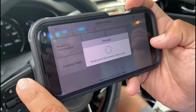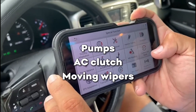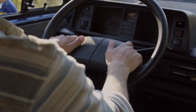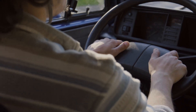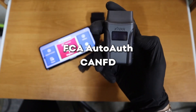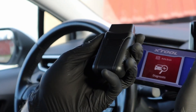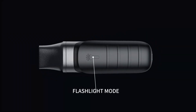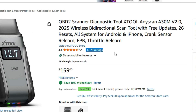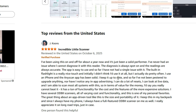The bi-directional control is very handy — you can run active tests from your phone like moving wipers, AC clutch, or pumps and see the results live. The app also lets you graph up to eight live data streams at once, making it easier to spot trends during road tests or tuning. It works with vehicles from 1996 onward, supports CANFD, and includes FCA AutoAuth for newer Chrysler family models. Keep in mind, FCA AutoAuth may require separate registration and fees, and service availability can vary by model, so it's a good idea to check VIN compatibility first. It has over 1,000 reviews with an average rating of 4.3 stars, matching its reputation as a capable, no-nonsense tool.